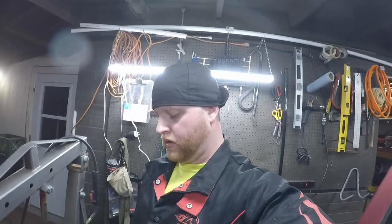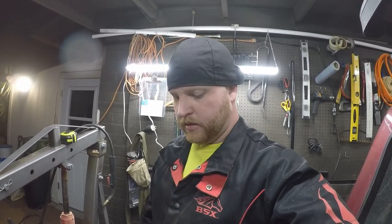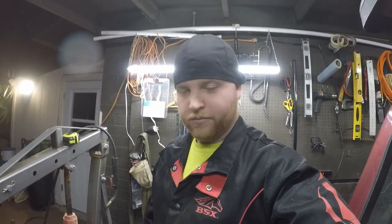I've literally been running back and forth for the last hour and a half — moving a little, moving a little, constantly measuring. The biggest issue people have is called thrust angle, which is the alignment of the rear axle to the front axle. This should be pretty damn close — as good as I can get it without laser aligning. I'll throw some more welds on here real quick, then we'll take the crane away and see what we've got. I'm nervous, but excited.